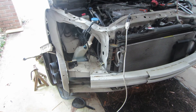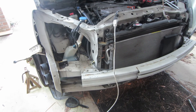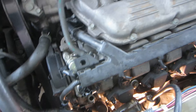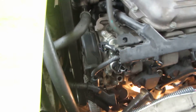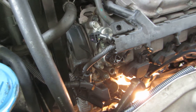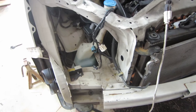On this particular one, there was a very stubborn, super tight nut on top of the alternator — the one that holds the main cable. I've never seen one that tight before. If I had twisted it more I would have ruined the cable, so I had to use vice grips and a screwdriver to hold the cable from twisting while putting a lot of pressure on that nut to get it off. I would have had to take the cover and headlight off anyway on this one.